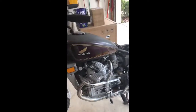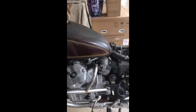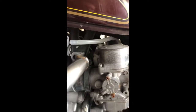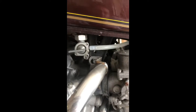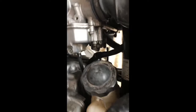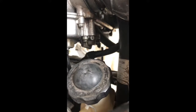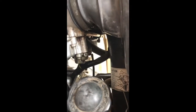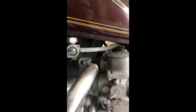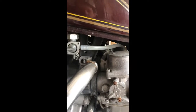Not a whole lot happened. I did replace the fuel line. I wanted to check if it was leaking from the petcock itself or if it was a bad hose. I really think it was a bad hose, because all the connections at the petcock were good — it was not leaking from the petcock. But it was leaking like a sieve underneath, somewhere in the carbs. Couldn't really see where. I really think it was just an old cracked fuel line causing the leaks by the petcock, which is good news — one less thing to replace.